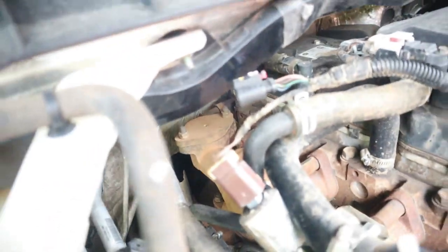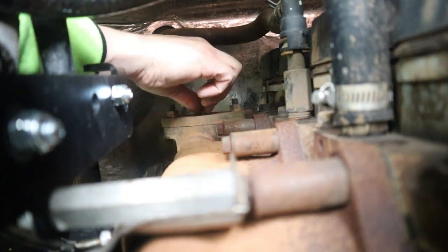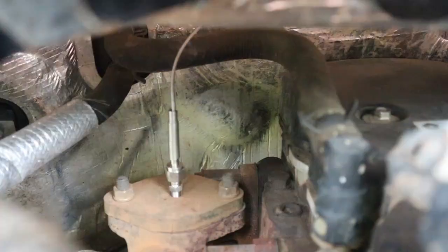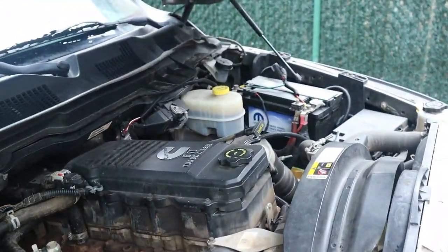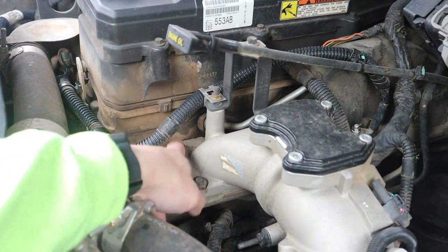You can see a little plug right there — that's where I'm going to tap in for the EGT probe on the exhaust manifold, which has a five-millimeter hex head. I'm going to break that loose and get the probe put in. We got the EGT probe in and fed the wire over the top of the valve cover to this side. We'll plug the wire in and tuck it down after we get the rest of the sensors in. Next we'll move to the boost sensor right here, then work on the fuel pressure. Over on the intake elbow we'll pull out the inside bolt — that's where our threaded boost gauge bolt will go.